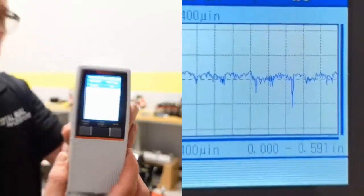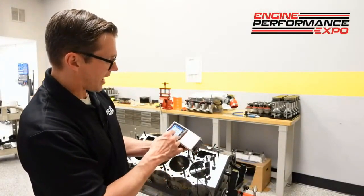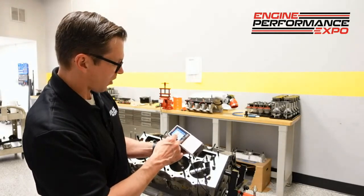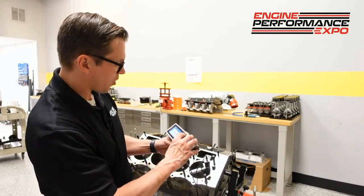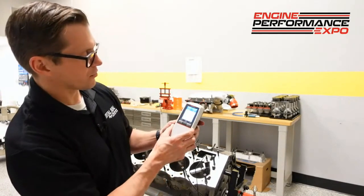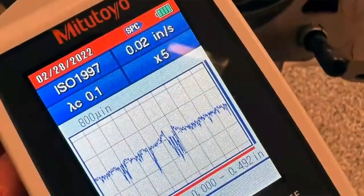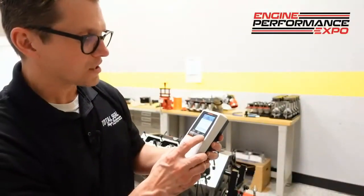It is so bad. And you can see right off the bat: the RA is 23, the RK is 58, the RVK is 80, and the RPK is 21. And again, you look at the cylinder trace and it is all over the map — all kinds of crazy peaks and valleys, really ugly.